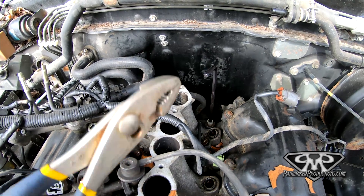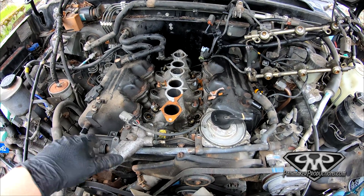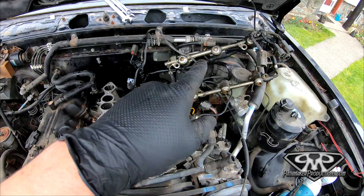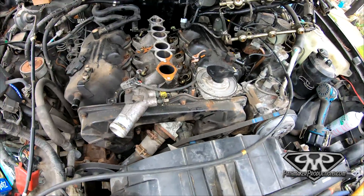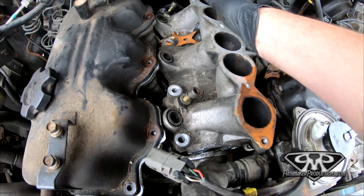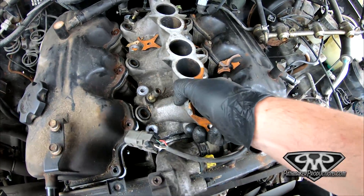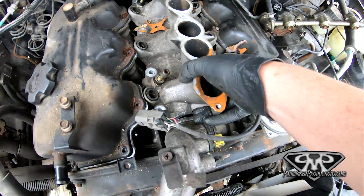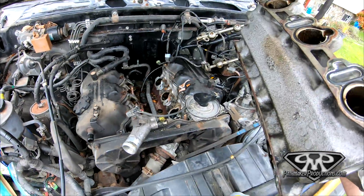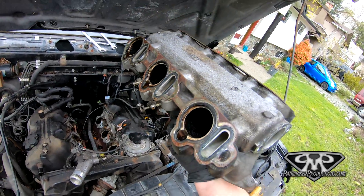Thankfully that wasn't so bad - working around here with half-assed tools, it's the story of my life. I popped off the upper rad hose, this valve cover vent hose, and put the fuel rails over there. I think I got everything free enough that I can pull this intake manifold off. There's studs in the end of the block so it's always a little harder to get off. Winner winner chicken dinner - looks good. Gaskets even look good. Happy with that.